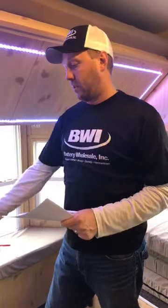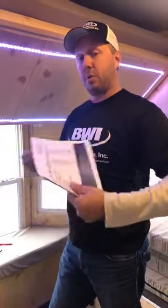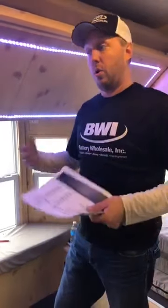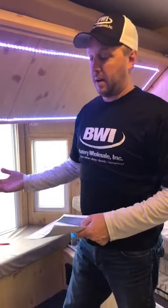If you go up to 31 like I have here, there's 100 amp hours there. So with my two batteries, I actually have 200 amp hours of capacity. Look at that as your fuel tank. Every hour as you pull out a certain amount of amps, you're only left with so many to use before you've got to go to a gas station, or plug it into your generator and kick it back in.